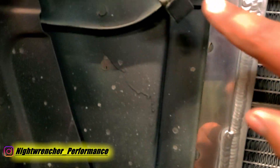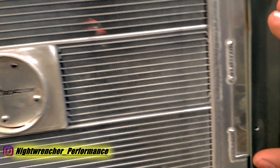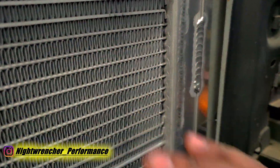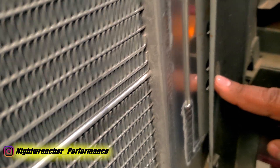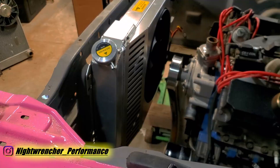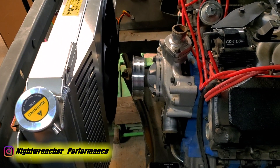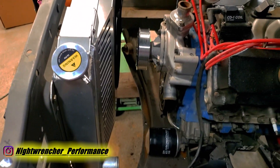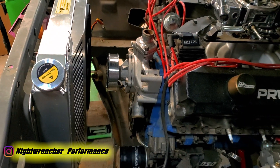The passenger side bottom hole sits higher than the driver's side bottom one, probably because this radiator is actually shifted a little to the passenger side on these cars. I scooted the radiator all the way to the left until I could see where the slotted holes were, picked the bottom one, aligned as best I could, and drilled. The whole thing is completely installed now. There's plenty of space between the radiator and the serpentine belt drive pulley — about three inches — so we have plenty of room.